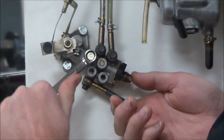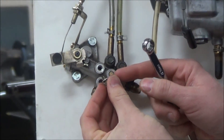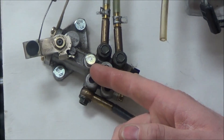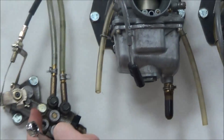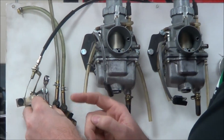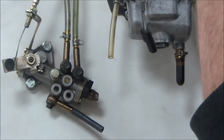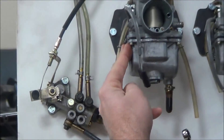Once the engine is actually running, what we do is loosen this fastener right here. I'll take it all the way out — the reason I know it's the bleed is I have a crush washer. On two-strokes, be careful because they vibrate a lot; you don't want to turn that out too many threads, and you definitely don't want to walk away from this. Crack it loose, hold onto it, flip the throttle, and you'll watch air bubbles burping out. Once you have a solid stream of oil, there's no more air trapped in the pump. By cracking the feed line, you know all the air is out up to the tank; by cracking the pump bleeder, you know the air is out of the pump. But there is still the possibility of air in the lines going to the manifold or engine.